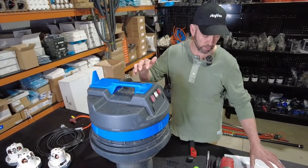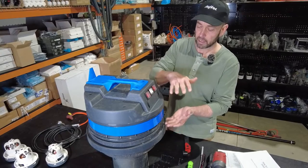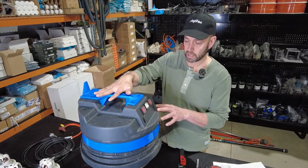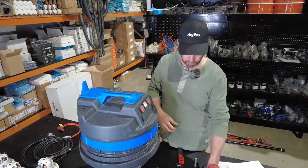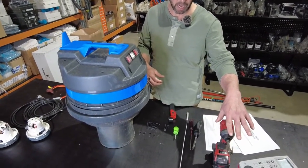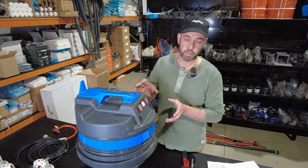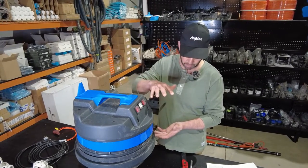Before we start, we've read the instructions fully, and we'll note the vacuum system is made up of different layers. The first layer is the handle assembly, which covers the capacitance and wiring. In this particular process, we're going to skip removing that and go straight to the upper cover. We'll need a couple of different tools: a Phillips screwdriver and some plain screwdrivers. If you've got a battery-operated screwdriver where you can control the torque, that would be great. When you pull this apart, do take note of the screw length. The first time you do it, there are a lot of layers and screws that make up this assembly and sub-assembly.